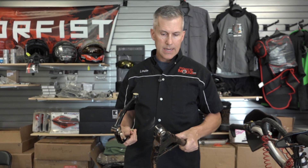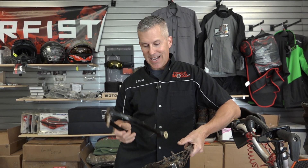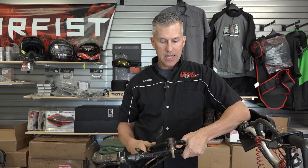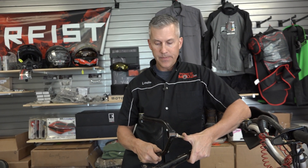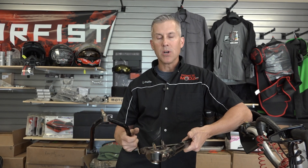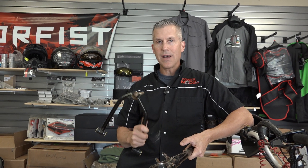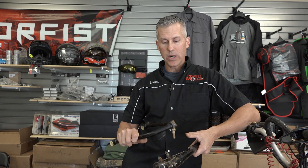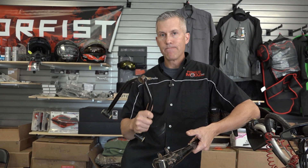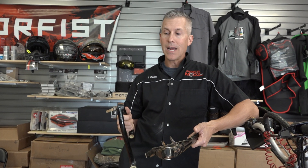So this is the kit I was running on this sled - 36-inch stance as well. I'm ditching it. There are a couple issues. Number one, it's very hard to get these ball joints, these upper joints and lower joints, especially in the middle of the season when everybody's blowing these things off, or if it's a low snow season and people are having a lot of impacts. These crack, and earlier on with the Polaris sleds you'd have to buy a whole arm just to get the ball joint. We're having problems getting these ball joints - we're down for two or three weeks in the winter and when the winters are like they've been lately, you don't have time to mess around.